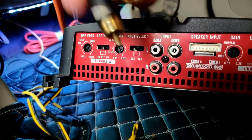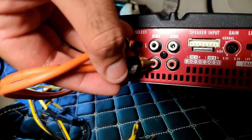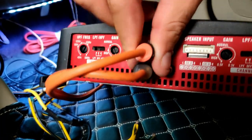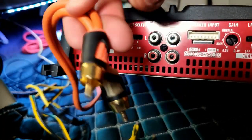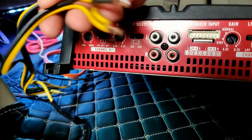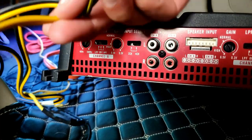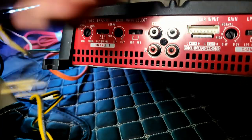You simply connect the other side of the lead — they are exactly the same on the other side. I've already installed it in my vehicle. I've connected both the leads to the subwoofer out of the head unit stereo. These are the speaker connectors; they are doubled because the subwoofer draws a bit more power. The positive is here and the black one is the minus, and this is the earth or ground.